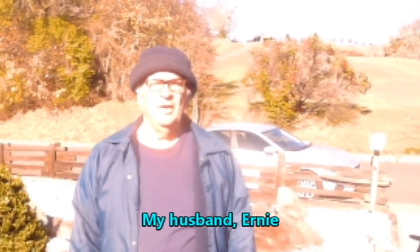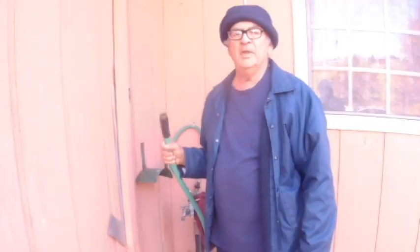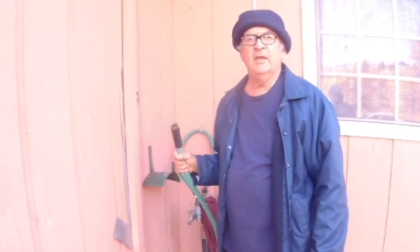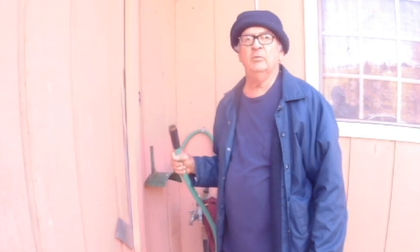Today we're going to sanitize our freshwater system with bleach. It's 1 cup for every 50 gallons, so if you have less than that, you can cut it down accordingly. Our tank is 40 gallons fresh with 6 gallons of hot water, and adding that to the lines, it's pretty close to 50. Our main hose has been disconnected and drained because when you pour bleach down a hose, you can't have any back pressure, otherwise you'll end up with bleach all over your hands and whatever you're wearing.